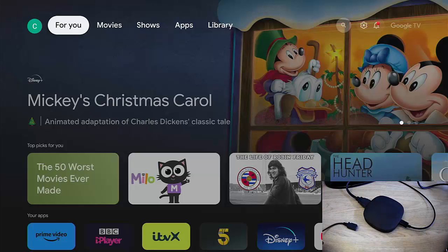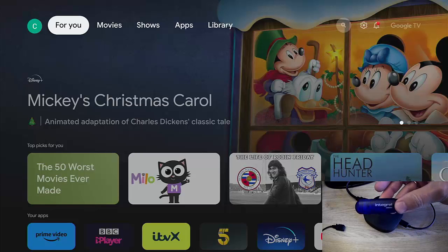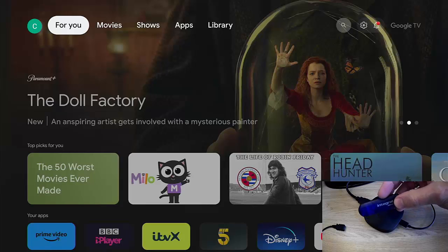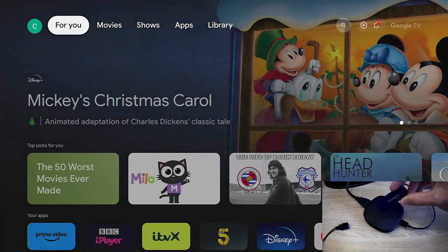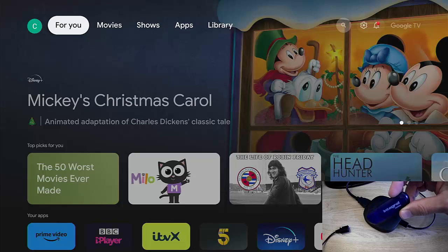You're also going to need a memory stick or a hard drive. I've got a small 32 gig memory stick here, and that memory stick needs to be formatted to FAT32. There are some devices which will accept NTFS, but I think generally all of them will accept FAT32. By all means, try formatting to NTFS and put one movie on it to see if it will accept it — but my ONN box doesn't. It just says there was a problem with the drive. I had to format it to FAT32.